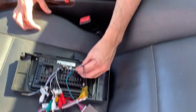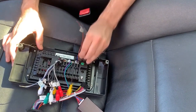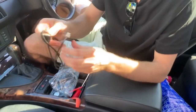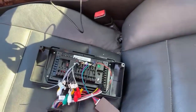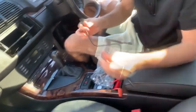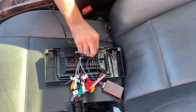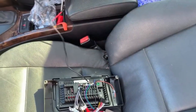There's also a reverse camera line — if that's wanted in the future you can plug the camera into this. Next we have our six-pin USB cable. This will be a default for anything you want to install, or charging your phone, CarPlay, anything extra like that. I'll first find a spot to run this before we plug it into the back of the system — I'm just going to run it out of the top because there's a gap there. These X5s are really quite tight and well built, so it is pretty hard to get in between the panels.